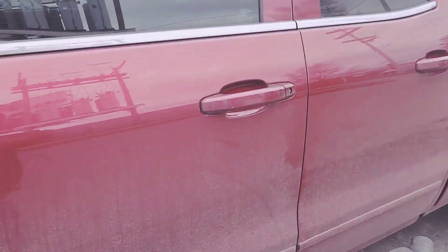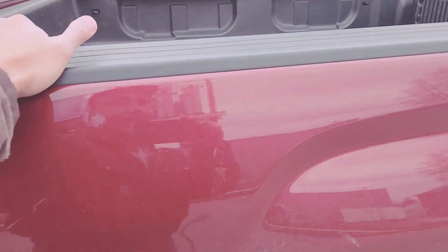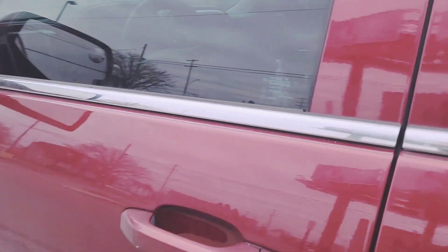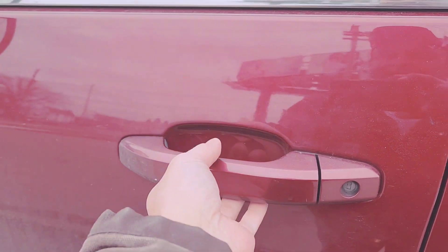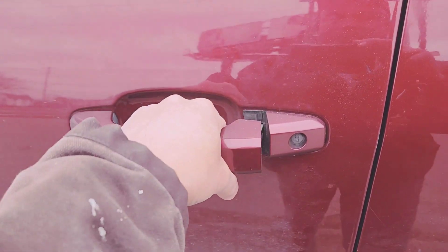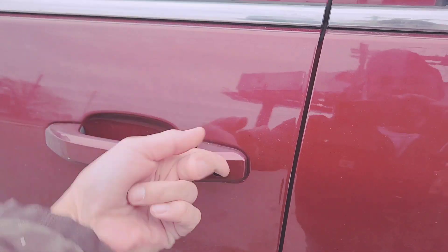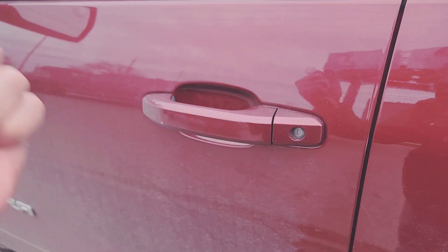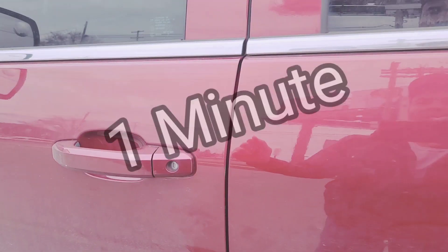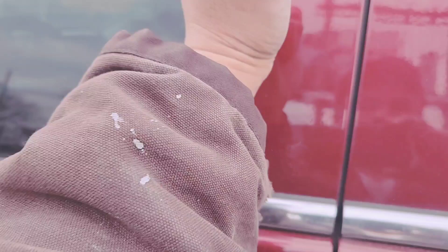It's cold outside, so I think it's been 60 seconds already. What a lot of people do is just come and shake the car — it's not going to do anything. It's just a shock sensor. Shock sensor means it responds to impact. A lot of cars, if they connect the sensor to the alarm, which a lot of cars don't have, it's not going to work from shaking. But for most people that want to steal your car, they're going to take a flathead and push it in and twist it. That will make the alarm go off once they open the door — the impact. So I'm going to show you the impact. If you kick the tire or try to pry it, it will go off. Let's say I do an impact — see? Depends on how much sensitivity you want.